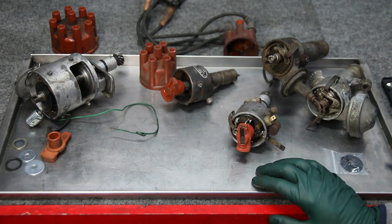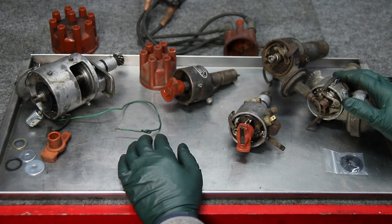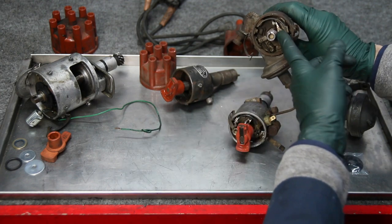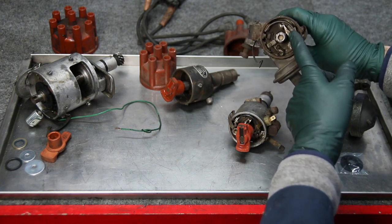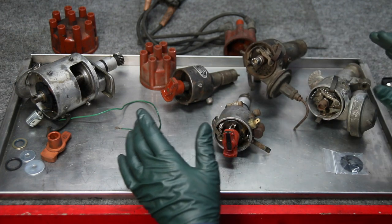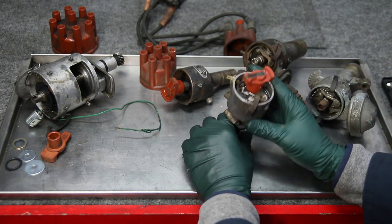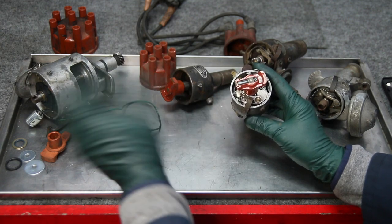Today I'm messing around with old Mercedes distributors. You can see an assortment here on my bench from the late 50s to the early 1970s. All of these distributors have points, and you people who've been around old cars know how troublesome distributor points can be when they get pitted and corroded, or when you let a car sit and suddenly it won't start. So the best upgrade you can make on your older Mercedes-Benz gas engine car is to convert the points to an electronic ignition — just get rid of the points altogether.